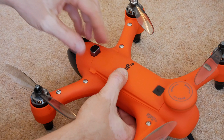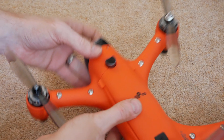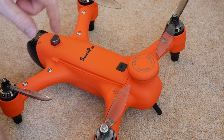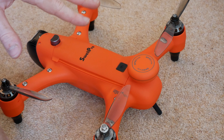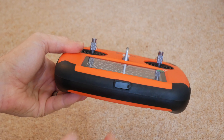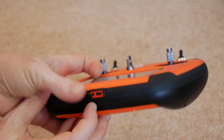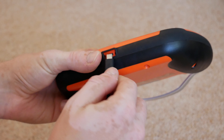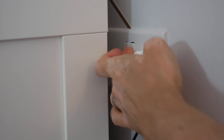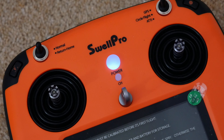Get the case back onto the top, press firmly down, and make sure it's flat and an airtight seal. A nice feature on this drone is that you can twist the lock to keep it nice and tight — that's how it should look when finished. To check the connection, press the button — you'll hear a beep, the propellers move slightly, and the red and green indicator lights will flash. To charge the controller, pop off the little rubber seal at the bottom to access the charging port, plug in the USB charger cable the right way around, and turn it on. During charging the power button glows blue; when complete, the blue light turns off.